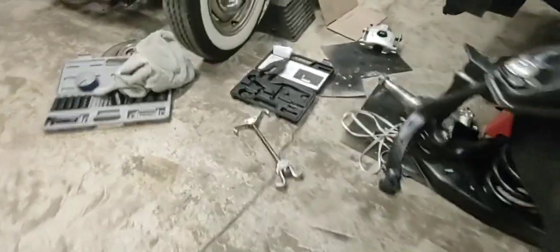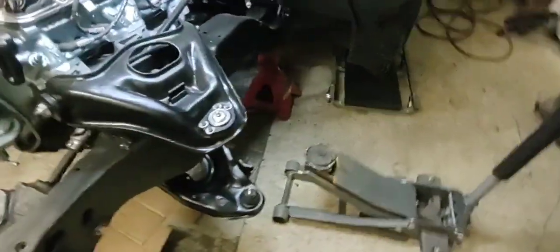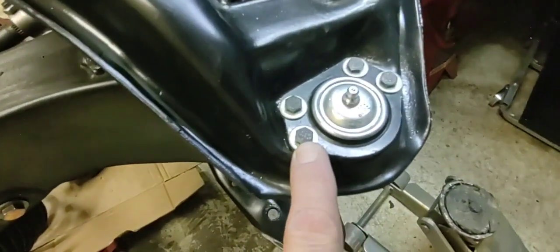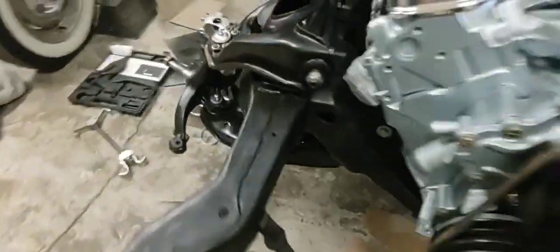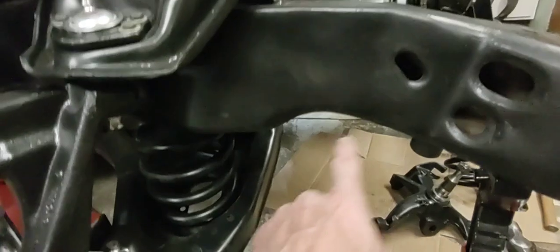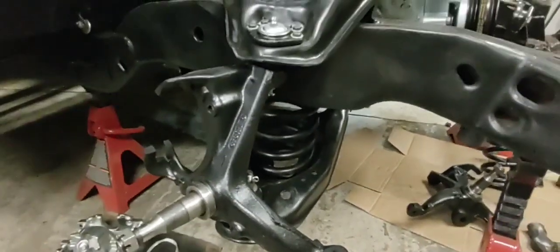It's always sketchy doing these springs, but glad I didn't get hurt using that damn thing. So I'm gonna battle this other spring in there and see how far I get. Yeah, I like those grade 8 washers here a lot better. They didn't mushroom out like them little cheap grade 5 ones. But yeah, and I did use my mill tape once I got it in there and compressed. I wrapped it around the frame and through the coils a few times and around the frame here, just in case it wanted to pop out, it wouldn't fly out and hit you in the forehead or something.